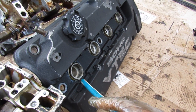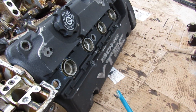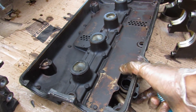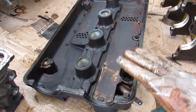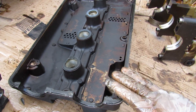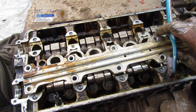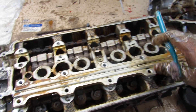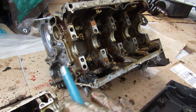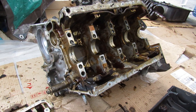It's been a while since I tore down an engine with a metal valve cover, but the H23 does have one — this being the black top engine, powder coated black with the VTEC head. That's a good thing because it's nice, solid, and strong, but it does add considerable weight, especially since the valve cover isn't structural. Many new engines, even Honda ones, have moved to plastic valve covers, which can be controversial due to heat cycling causing warping and leaks. Overall, Honda has done a good job with things like the camshaft bracings and ladder frame crankshaft support to make a very strong engine design that can take a lot of power. However, there are some gripes — the FRM cylinder liners and the fact that it still uses a timing belt — which makes the K series a good successor to this engine.